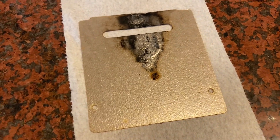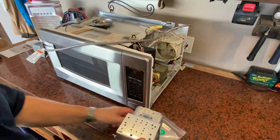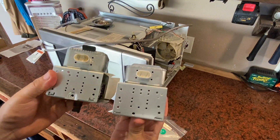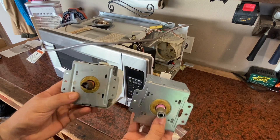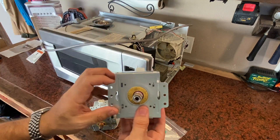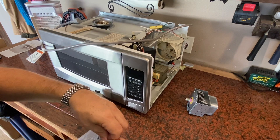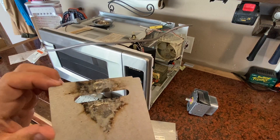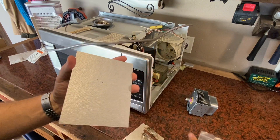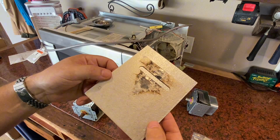Here's what my mica sheet looks like — it's got a big torched piece here. Replacement parts have arrived and here's what they look like. Looks like an exact match to the existing magnetron. Here's a new one on the right, right down to the holes on this portion here — very much similar. So you've got to measure across and lengthwise. In my case, they wanted the measurements from here to here and from here to here — that's how you're going to know you'll get one with the right size bracket. We've also got our paper replacement here, a mica card. This particular card is a cut-to-fit portion. I got two of them in my order. I'm going to trace this out with a magic marker and then do some trimming to cut out a match from this existing piece.